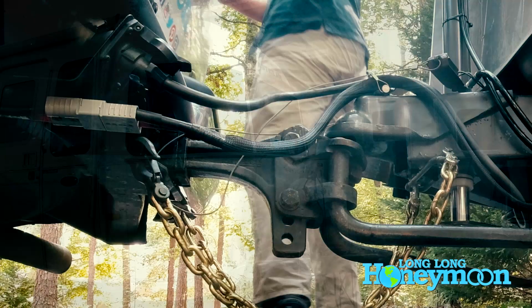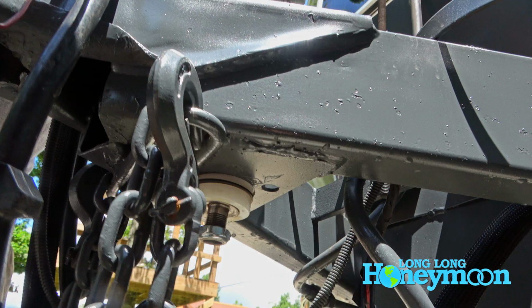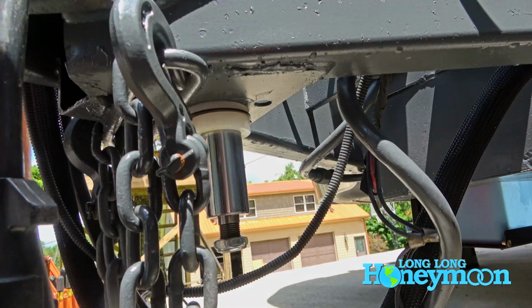Well, on an Airstream, because you have the propane tank cover and everybody wants to be able to lower the tailgate, you couldn't have the pump housing actually mounted on there. So we had to kind of figure out a way to remotely mount the pump to the trailer. They were willing to give us longer hoses so we could do it. And then what we've found is that you can mount the pump inside an empty battery box.